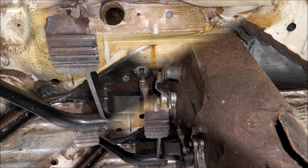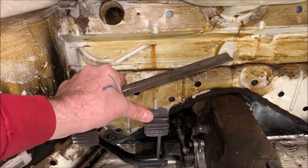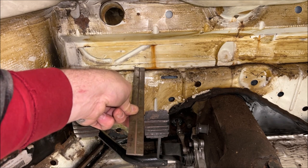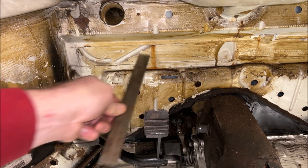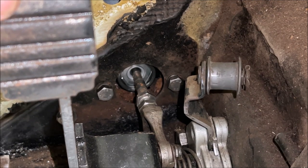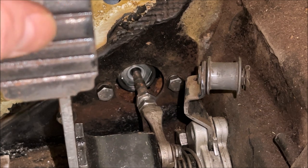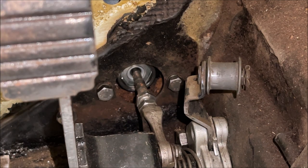When you are trying to do your measurement of five to seven millimeters of free play, you can hear it — it ain't doing anything but a little bit of play. Just take a measuring stick, put it against your firewall, and then push and see how much play you have. It should be between five and seven millimeters. When you have five to seven millimeters at the pedal, you should have one millimeter of play at the push rod.